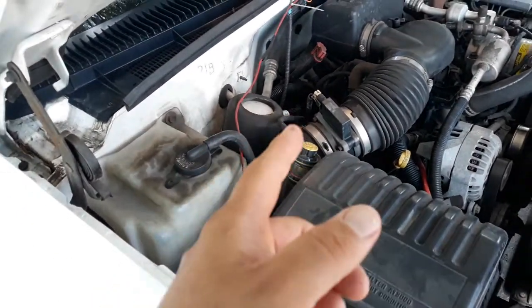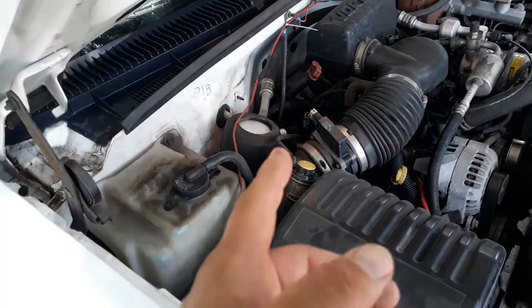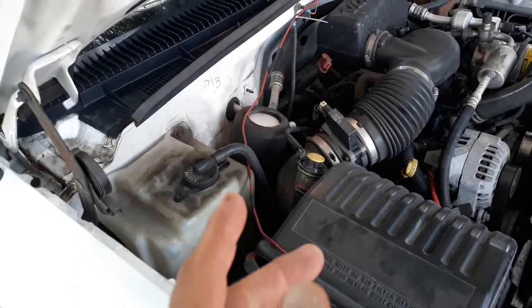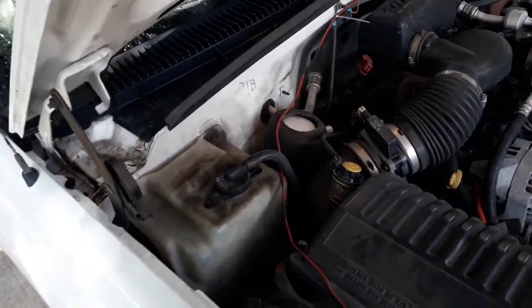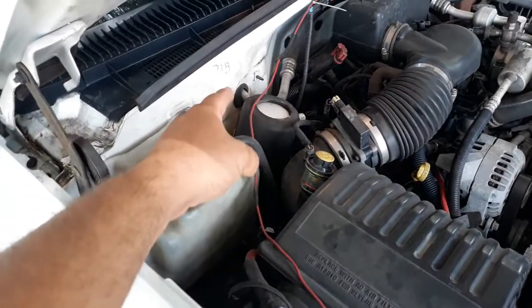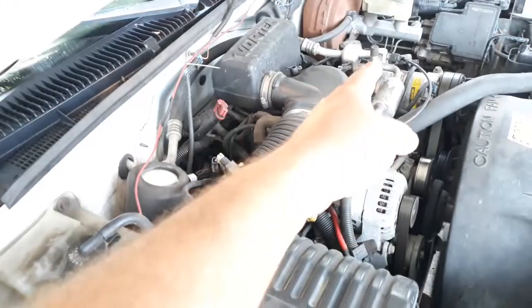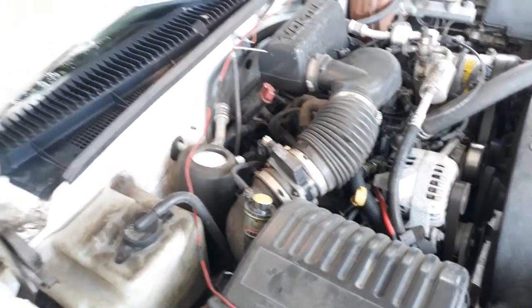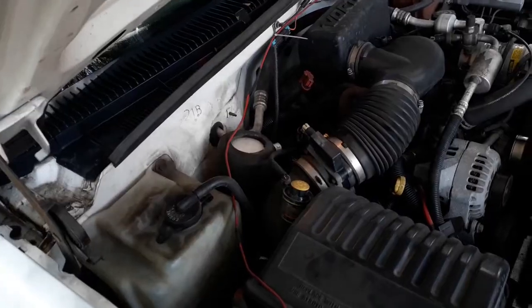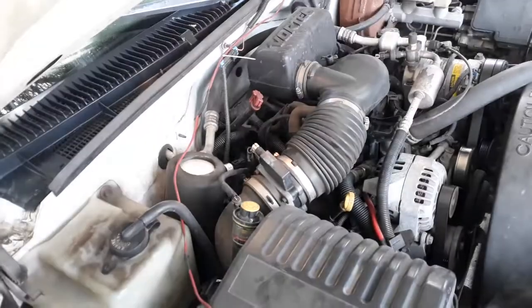I believe the sensor says it cycles off at some number of kilograms, but I don't have the conversion for kilograms right now. Roughly, this thing shuts off at, I think, 26 PSI on the low side, and then it comes back on at 45 PSI. Before, my accumulator would have been frozen by now, and also the pipe coming out, and given enough time, my line would actually be frozen all the way up to the compressor. And like people tried to tell me before, oh, that means you got too low of a Freon charge. Your Freon's low.